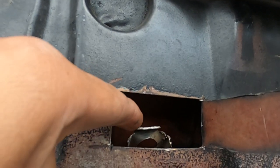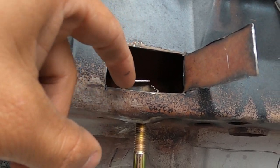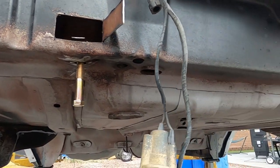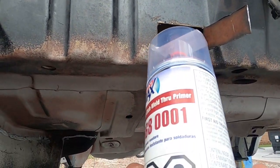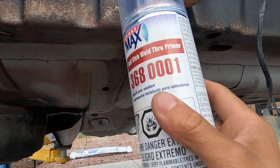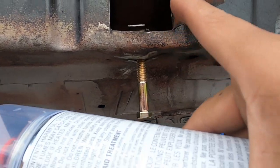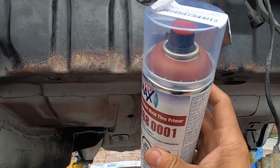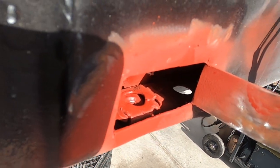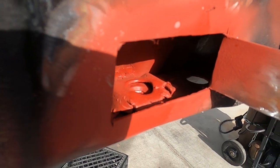All we got to do is flap that cover back over and smash it down — make sure it's all the way down, nice and neat so it doesn't move. Before you do that, I like to use weld-through primer. You can still weld over it, but it also helps keep rust out and protect this area before you close this thing up, because we already know moisture is going to get in there. I'll try to put a link in the description for that stuff.